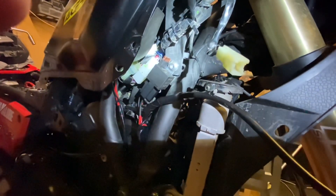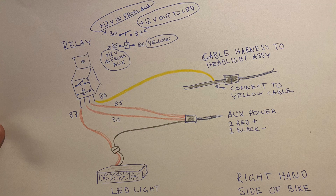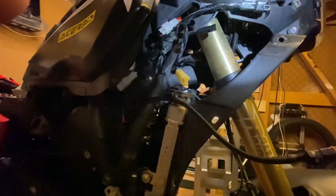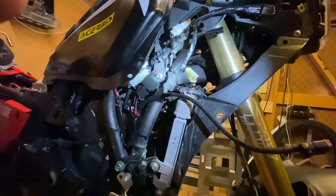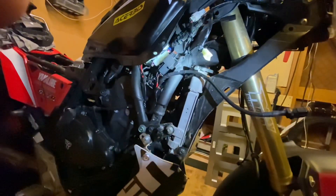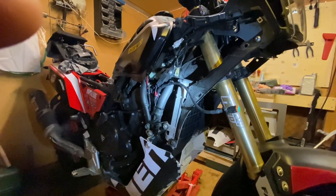Here you can see my relay — it has a built-in fuse holder and I currently have a 7-amp fuse installed. I'll put up a wiring diagram showing exactly how to connect it. You can see my cables routed neatly from the other side — this is the feed cable for the LED high beam. I also disconnected the stock port cable because I ordered a USB charger with a built-in voltmeter to connect there. I already tested everything and it works, so let's take it out for a ride.